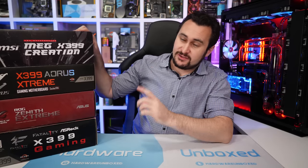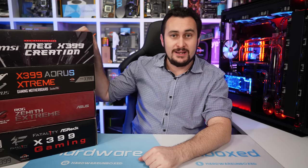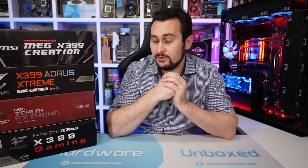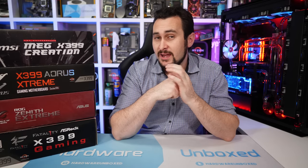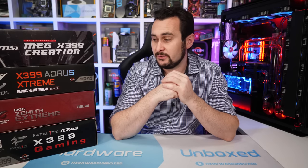Going into this, I expected the MSI X399 Creation to be the ultimate X399 motherboard, and in terms of power delivery, it certainly is. That said, when it comes to VRM thermal performance, the ASUS ROG Zenith Extreme certainly rivals it — though remember the ASUS has active cooling whereas the MSI board is completely passive. For extreme overclocking well beyond what I've demonstrated here, the MSI board will likely win out. But for more typical overclocks using 1.25 to 1.3 volts, there really appears to be very little difference between the ASUS and MSI boards. They both ran at just over 70 degrees installed in the Corsair 500D. The Gigabyte X399 Aorus Extreme was a bit of a mixed bag — it appears right on the edge at 1.25 volts, and pushing beyond 1.3 volts caused the board to power trip.